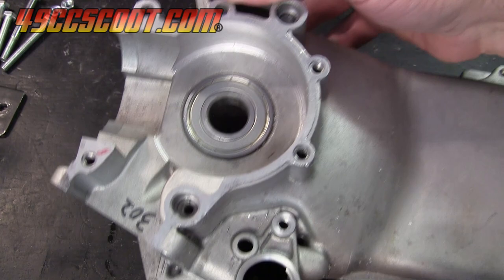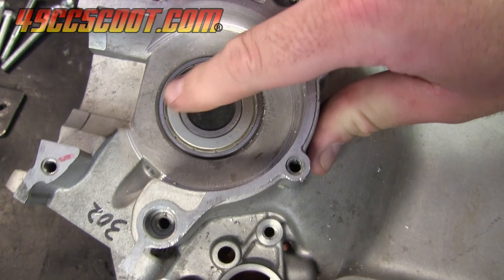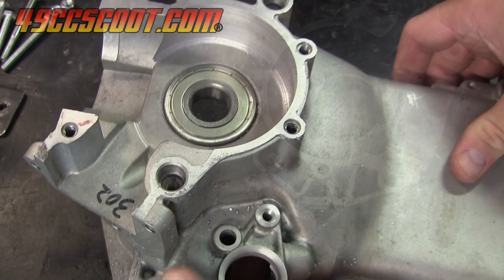You may also notice in some of the videos that I'm using a shielded bearing instead of the typical open crank bearing so that I don't mess up a bearing with metal debris from cutting. An open bearing could be used, but it would be ruined unless it was protected. I should also note that I did not use dummy bearings when cutting.